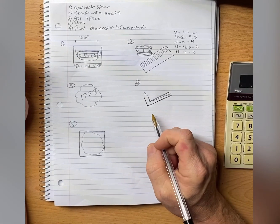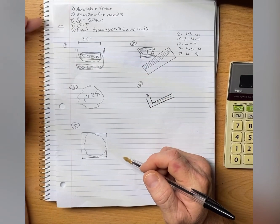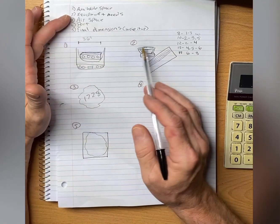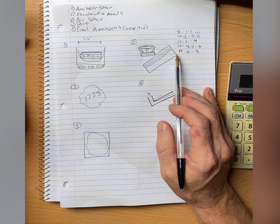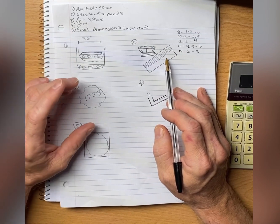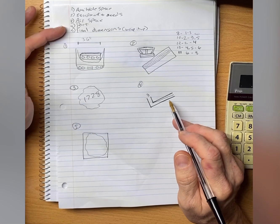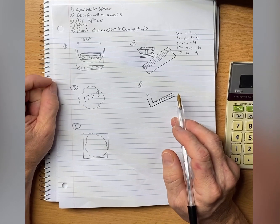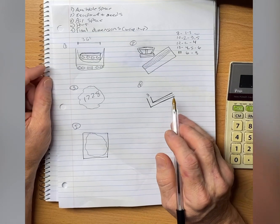But speaking of space, there are going to be five elements, 1, 2, 3, 4, 5, that we're going to look at. The available space, what size you can fit a box into; the equipment, to fit the needs and meet the goals that you're trying to achieve; the airspace that equipment needs to operate in; the port that needs to operate that airspace to get that into the cabin of the vehicle; and then the final dimensions, wrapping that airspace in the actual plywood itself. There's a whole lot to it, so this is definitely just going to be an overview.